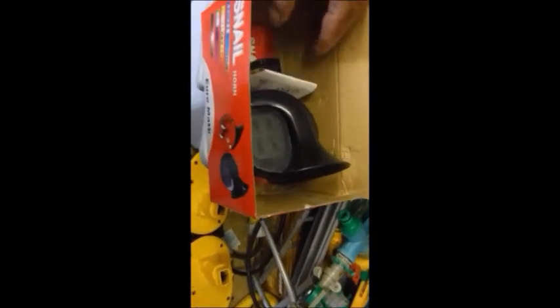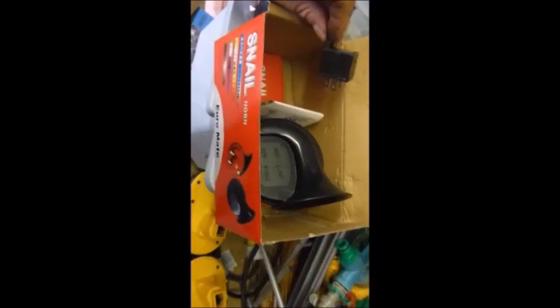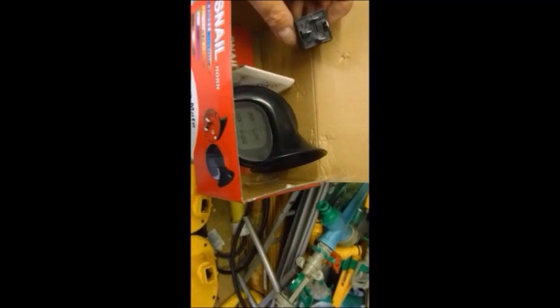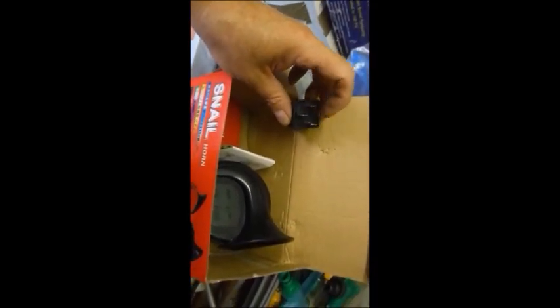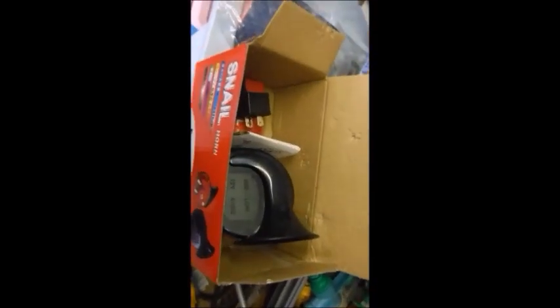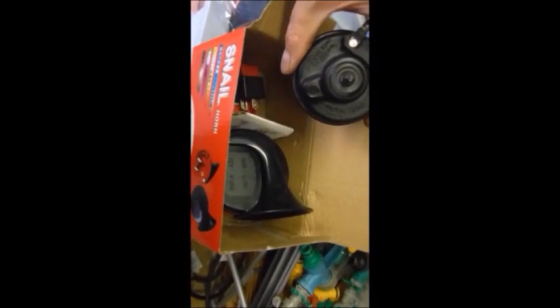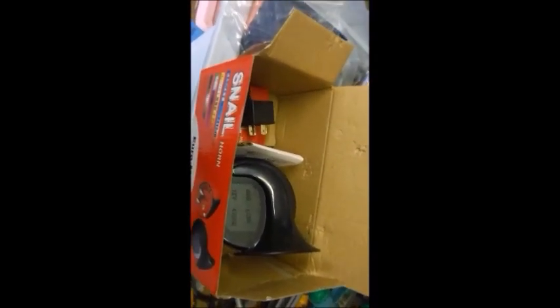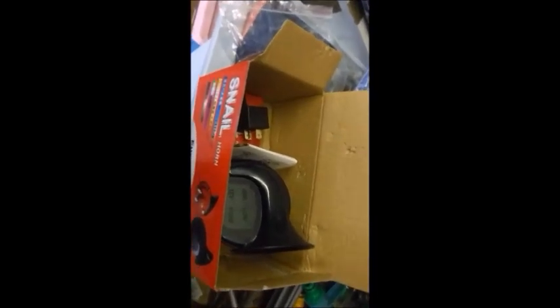One thing I didn't mention — this kit actually comes with a pair of horns but I'm only using one. It also comes with a relay. Most accessories you put on a motorbike will come with a relay. If you prefer you can use the relay, but if you do that you need to run a separate power for the horn. The existing two wires on the horn you'd connect onto the two terminals on the relay, then you'd have a power in and a power out. So when you press your horn button there'll be a millisecond delay while that clicks, then puts your own power to the horn with its own fuse. But it's the same rating as this horn, so it's not going to draw any more power. As I'm only putting the one horn on, I haven't bothered putting the relay in. The choice of course would be yours.